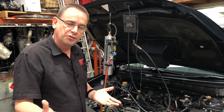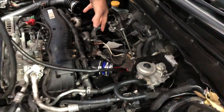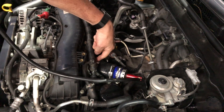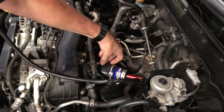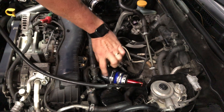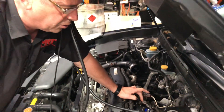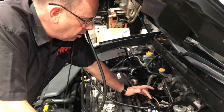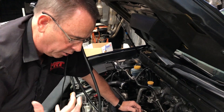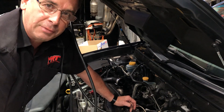I'd encourage you to look at our other videos where we've spoken about this. We pull the intercooler off, which normally sits here, and then check the pipes. One of the biggest things we check first is the connector pipe between the turbo and intercooler and the pipe that goes into the throttle body. At the moment the soot cleaning equipment is mounted there, but on a normal Subaru turbo diesel there's a flexible rubber reinforced hose — the pressure hose — which is well known to fail. We typically replace it with an aftermarket silicone one that lasts forever. These problems cause VGT turbo vane problems and DPF problems, so we want to make sure the car is in mechanically good condition before proceeding.